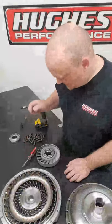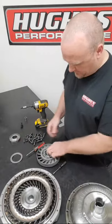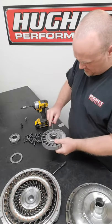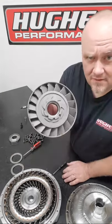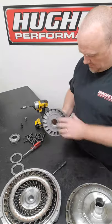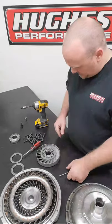When it comes to taking the bearing off, it's not a tight press fit, so I just gently pried it and the bearing pops right off. Then you have a stator cap retained by a snap ring. Some stators actually have a removable stator cap on both sides. You can see our Pro SSX fabricated steel stators only have one bearing cap - the other stator cap is actually integral to the stator. This makes life easier as far as remembering assembly order and getting the sprag oriented correctly when doing a stator swap.